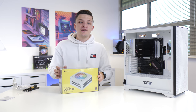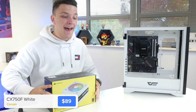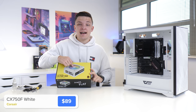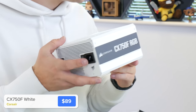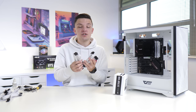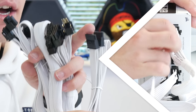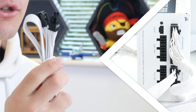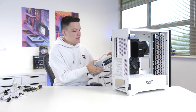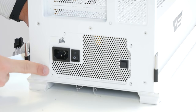With the motherboard installed, we move on to the power supply. This is Corsair's new CX750F — pretty similar to the CX750M which I recommend quite a lot, but it's white so it fits the color scheme and has RGB. When it comes to cables we don't need too many: a 24-pin motherboard cable, a couple of SATA power harnesses, a dual 6+2 pin PCIe power connector for the graphics card, and a 4+4 pin CPU power connector. We slide the power supply in with the fan facing downwards and secure it through the four screw holes.